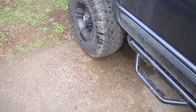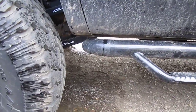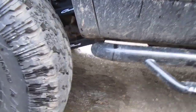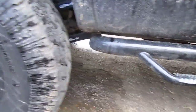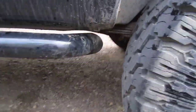In the instructions, N-Fab will talk about moving the bar front or back. They say you can get a half inch — maybe three quarters — for tire clearance issues. Normally it's supposed to be mounted up even here, but I went back a bit for my larger tires.